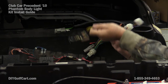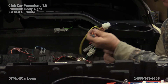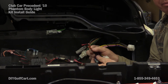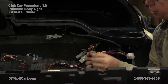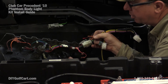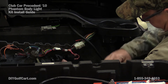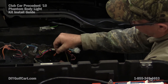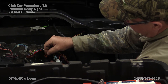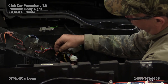Okay, now for the wiring harness, it actually comes up front here. For the relay first, if you'll notice, you have two large female spades and two small. If you look on the backside of the relay, you'll notice the very opposite — two small males — and what we'll do is we'll just plug them in, corresponding size. And it does not matter which one goes where.